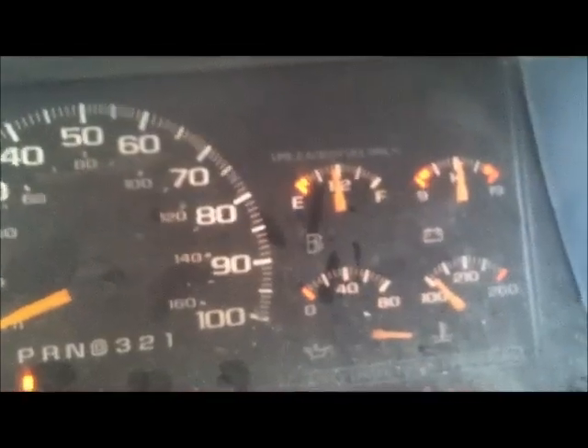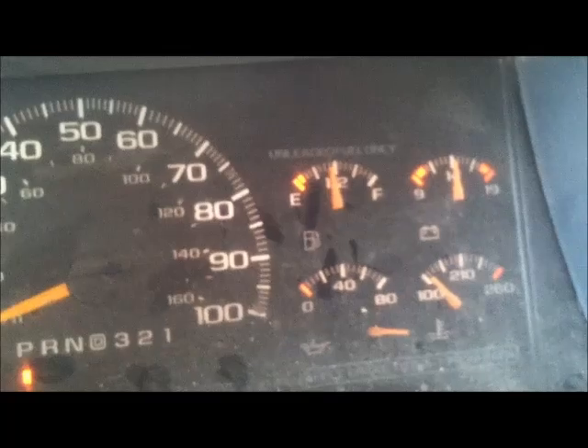Both turn signals on — I'm still a full 14 volts. My fuel pump was a problem; it wasn't kicking on because it was getting hot. I've got a little less than a half a tank and I had to keep adding gas because it would just cut out like I was out of fuel. It was letting the pump cool down — the extra fuel in it kept the pump cooler because the top of the pump is right about at the center of the fuel tank. It's just incredible that a ground short would cause that and make it feel like a fuel pump problem. Budafuco, you came through — love you man. Hope this helped you all, good luck.